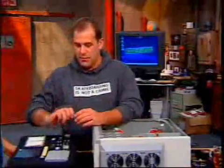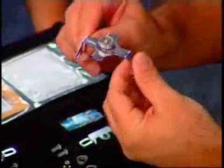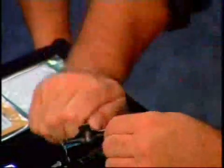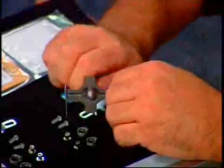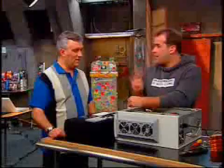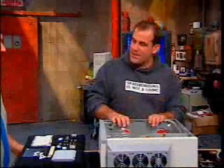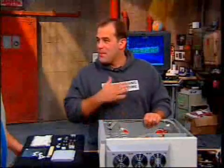I had a little trouble with the coolants. Just a few minutes before the show, I did not remember what comes in the manual. When you install the coolants, this is what holds the water block and the coolants down on the processor. If you don't turn it until it clicks — which feels like it's going to break the chip — it's not. Turn it until it clicks, or you're going to fry an AMD Athlon just like I did. You fried another one? I fried one. I fried another one — my own personal ones. Two of my own personal ones I've fried.